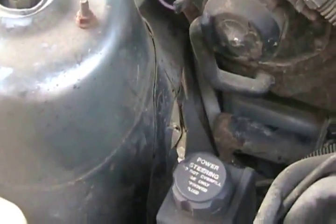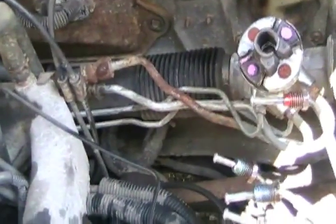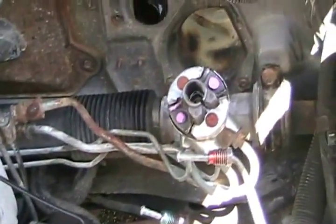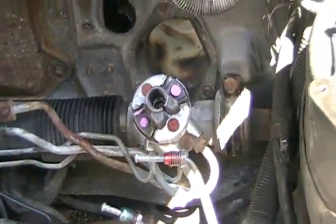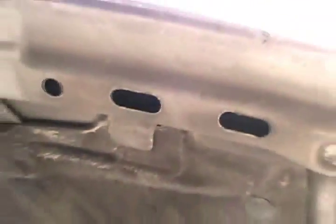And now I have to custom modify the long tie rod on that side a little bit. This side needs no modification, I just need to make the angle L bracket now to reattach the tie rods to. Simple as that. And this totally clears the transmission and all the workings under the hood to run the shaft out. I just have to cut a slot in the hood like the last car.